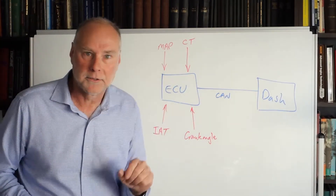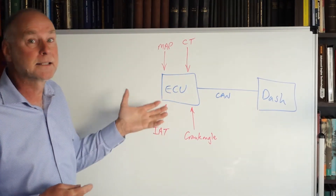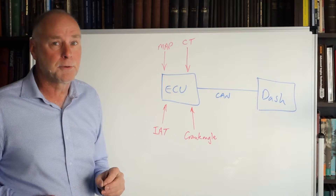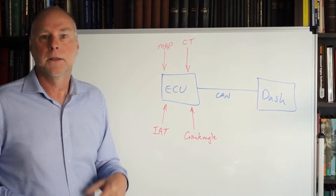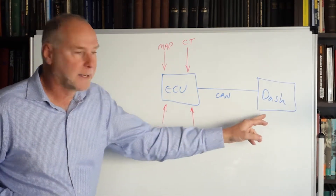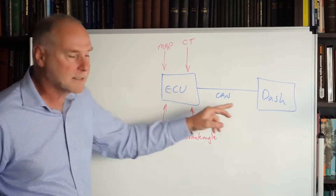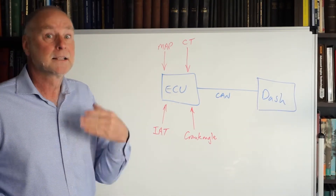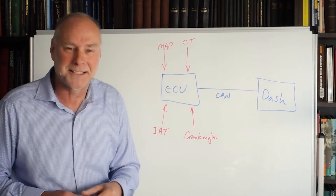You don't want it to be able to send only coolant temperature and manifold pressure — you want to be able to send basically whatever information the ECU is coming up with so you can display it. When you are tuning, especially on the road, being able to set whatever you want sent to the dashboard is so useful. It might be an auxiliary output duty cycle so you can monitor what your idle speed control is doing on your dashboard as you drive. It might be the boost control solenoid duty cycle — so you can monitor how your mapping is going by watching just your dash and not also trying to watch a laptop at the same time.